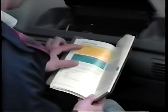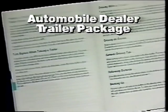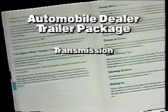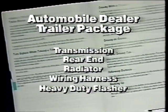Okay, now that you have a boat with the proper trailer, how do you make sure your vehicle has the horsepower, transmission, and rear end to tow the trailer, boat, passengers, and gear? Simple. Consult your vehicle owner's manual. There'll be a table showing how much gross weight and tongue weight your vehicle can tow. Also available from your auto dealer is a trailer package usually consisting of different transmission and rear end, larger radiator, wiring harness, and heavy-duty flasher.